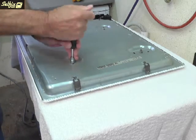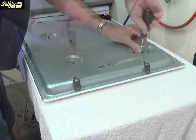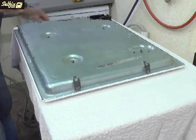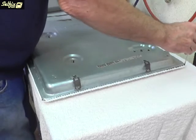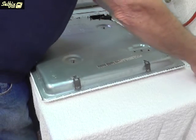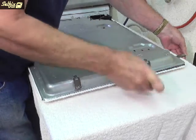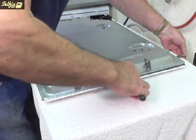To work on these units the base cover needs to be removed, but the first thing to come off is the mains cable. There are four 10mm nuts holding the base cover onto the hob. When they've been removed you can lever the cover free, but before you do that, unhook the junction box and remove the one screw holding it onto the cover — this will make handling the hob easier later on.